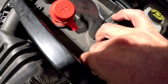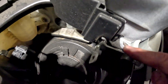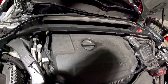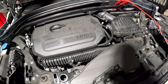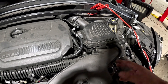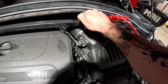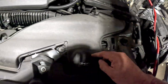Push pin in, 8mm. Still need to get that one in the back. Make sure the pins are in — some Clubmans will have a 10mm here instead with the crossbar. But everything is back together. Long story short, that's how we do the batteries. It's going to be pretty much the same on all F-series. There are just two different steps between the two-door, four-door, and Clubmans. The Countryman is pretty much the hardest one — some people don't take the bracket out and just slip it out, but it's up to everyone. Just go over and make sure everything is back in where it needs to be.